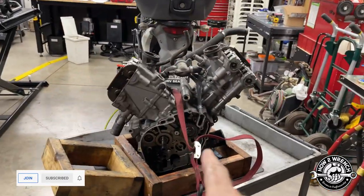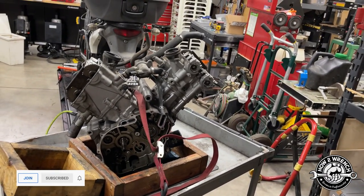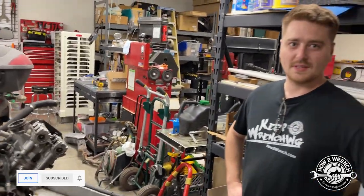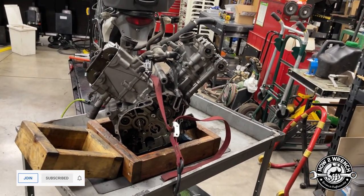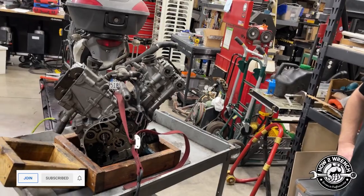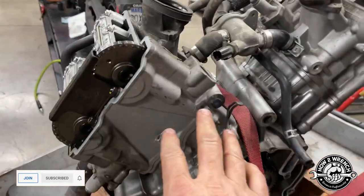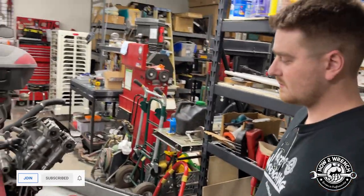If I put this motor back together and had never checked spark and it didn't have spark, I'd be asking 'did it even need a rebuild?' You get yourself into all kinds of trouble. When you do deep diagnosis and verify everything you can, it's killer — the work order shows we physically proved it had spark front and rear, and we already know the cooling system will not hold. So we're going to spend a lot of time looking at the sealing surfaces and passages.